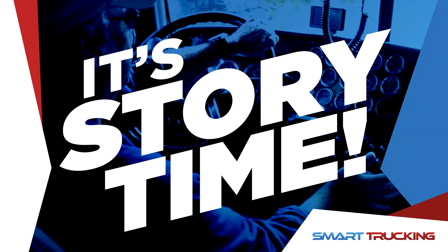Let me tell you a story about a local guy who didn't clean his fifth wheel off and grease it, and it cost him big time — and the company big time too. There was a local fella up here, a nice fella, but he just didn't like doing maintenance on the truck. His trailer plate was dry, the fifth wheel had gone dry — he didn't notice because he never uncoupled the thing. The friction between the trailer and the fifth wheel was enough to bind and push him into the ditch, and he wrote the truck and trailer off.